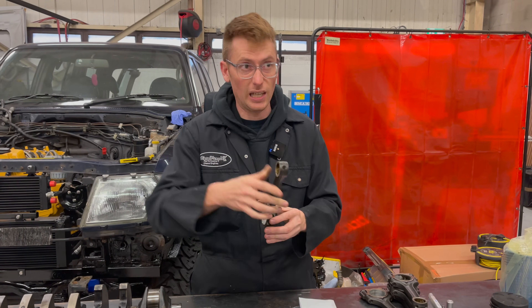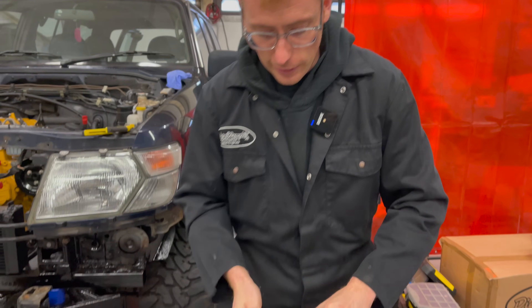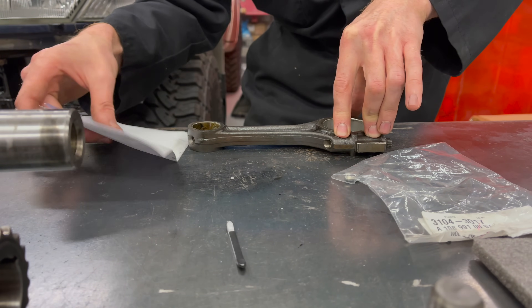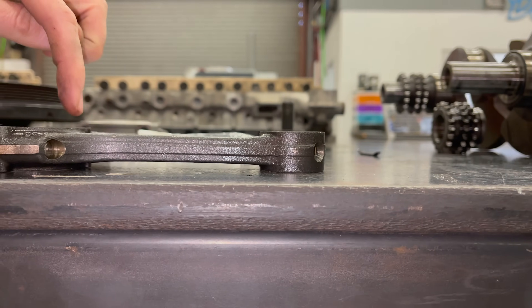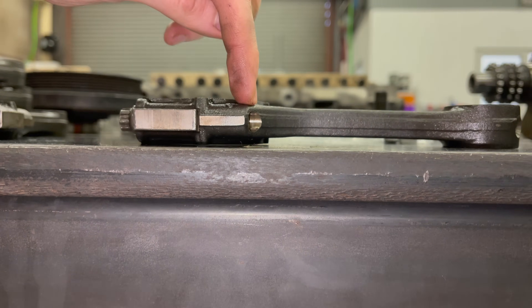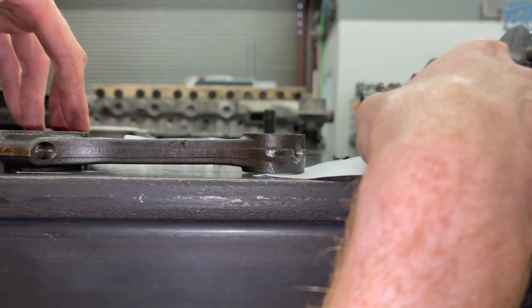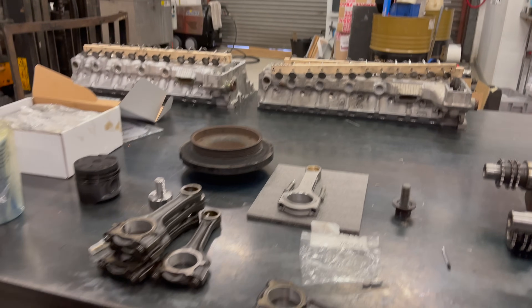This is one I just took apart this morning. What you do is take your rod, make sure your cap's properly bolted on, lay it on a nice flat surface, and you'll find that you can slide a piece of paper under it one way. You're holding down tight on the big end and can't get any paper under it the other way, but this way — easy peasy. If I push on the big end here, you can see there's a gap under the bottom of the big end towards the front, but there's no gap under the little end. Now if I flip that over and push down hard on the big end, look how there's now a big gap on the little end, and you can see the paper will go underneath. Every one of these connecting rods has this issue — every single one of them is bent.